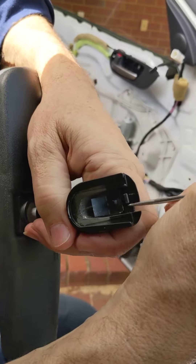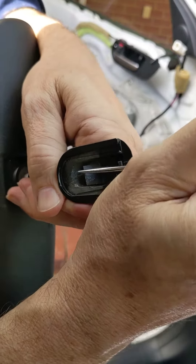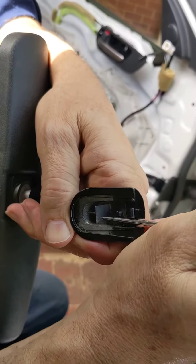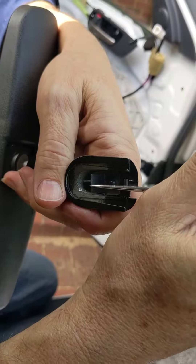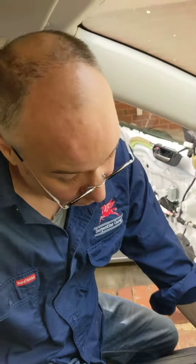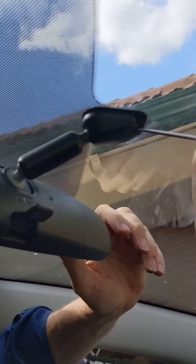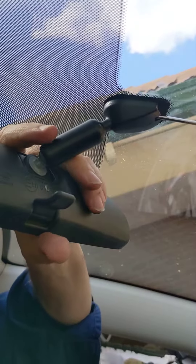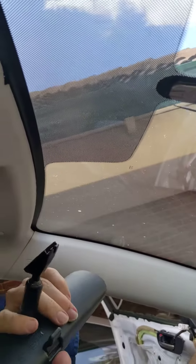So to get them off, you need to take your pick, put it through the notch and press down on that piece of spring steel to get it to release. To show you that happening for real — if we go to this one here that's installed on the windscreen — there's my notch, here's my pick. I'm going to put the pick up in the hole, press against the piece of spring steel and wiggle it off.